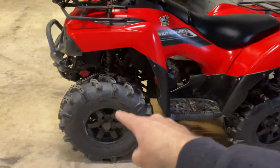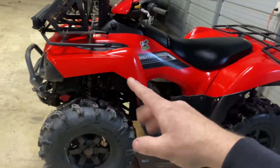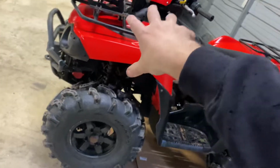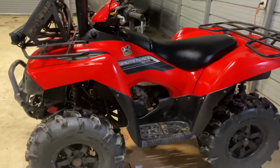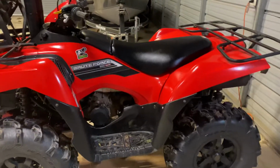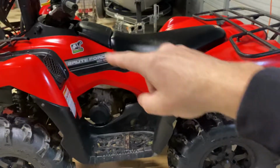It took time. I had the wheel off, the plastics off, the airbox off, and I was able to get to it all. It's not easy to get to, but I got to it. On the front one, which is going to be the exhaust valve on that side, I had to just one-hand it. I had to take my right hand in there, flip it this way, and just kind of get to everything like that. I had to go back and forth, and the ass kicker about it is once you adjust them, you put the caps back on, put everything back together, start it up, and make sure it's running good. So there's that. Like I said, I either have a small tick or an exhaust leak because it doesn't quite sound like it's coming from the valves.